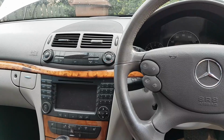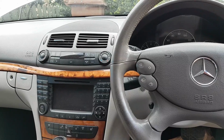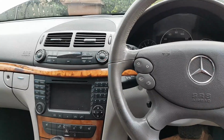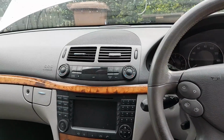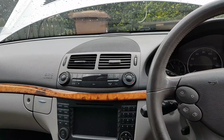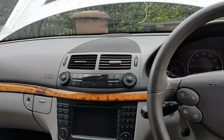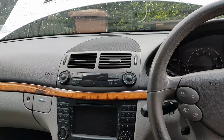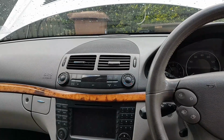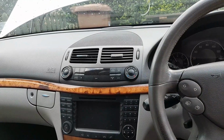This video today is on a 2006 Mercedes E320 with, I think, the OM642 engine, so it's the V6 engine. And I've done a video, which I will leave the link to in the description below, showing you where most commonly you can have an oil leak on these engines. The oil leak will reveal itself somewhere on the gearbox area, but it actually comes from the oil cooler, which is fitted in between the V of the engine, between the cylinder heads.